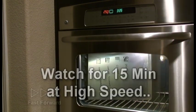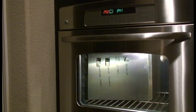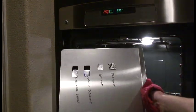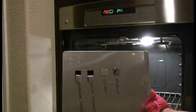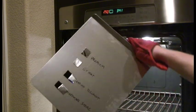So it only takes about 10 or 15 minutes at 250 degrees for stuff to start happening. And what you'll see is the leading discount and the hardware store brands, they start to slide pretty dramatically. So this is a good time to ask yourself, is this a feature in my sound deadening that is important to me? Well, if you live in a climate that has a hot summer, or you're going to be putting your material in your car somewhere near a heat source, say the engine, or maybe your climate control, or maybe the exhaust, then I would say it is an important factor for you.